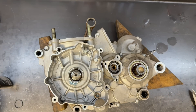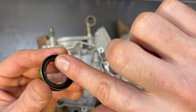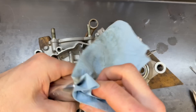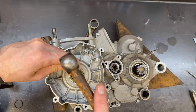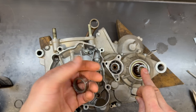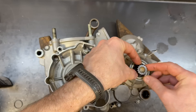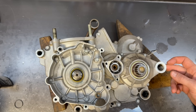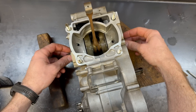Now, left side. I didn't have to buy this crank seal because it's the same as a KTM one, and I change them all the time so I have them in stock. Same thing here — I'm going to put some grease around this inner lip because it is possible to fold these as well. For this one, I'm going to use a socket and make sure that my socket is clean. These can be difficult — you want to make sure to do it very straight. Finish it with the drift again, just go flush. Now, this isn't technically part of the bottom end, but this is the output shaft seal. I'm not replacing this because I don't have one, but this engine doesn't have particularly high hours on it, so I'm not worried. And if it did fail, it's very easy to change. That's why I replaced that center case gasket even though it was like $60 or something — quite expensive for one gasket. Now I can feel there's a little bit of extra resistance, but because I checked the crank initially, I know that it's just due to the seals, and that's very common.